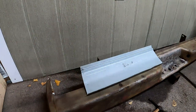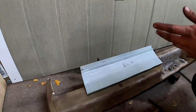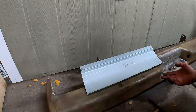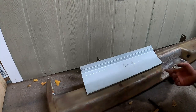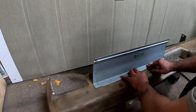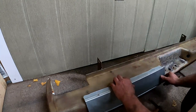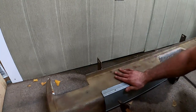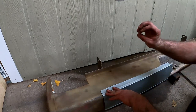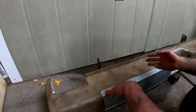We've got a little bit of a change of plans — our vise at home can't do the vising I need, or act as a brake. So we're going to make our own, meaning use what we got. My usual go-to is a cinder block, but I don't have any at the moment. This bumper here that's about an eighth-inch thick will do just fine for this petite metal. I started flattening it a little bit — it's better than it was. We're going to massage it a bit and try getting the inverted part of the bend in. This is where being creative comes into play.